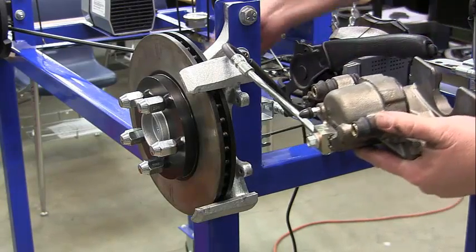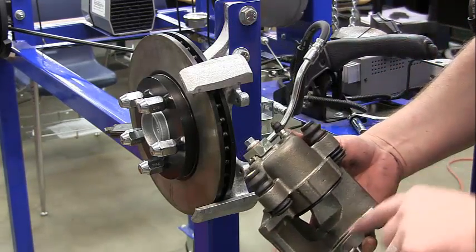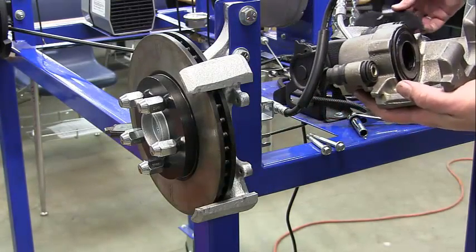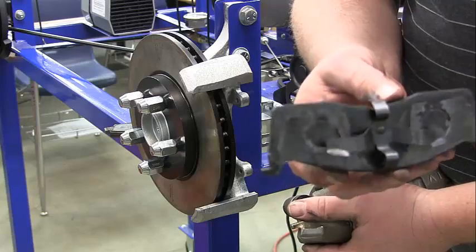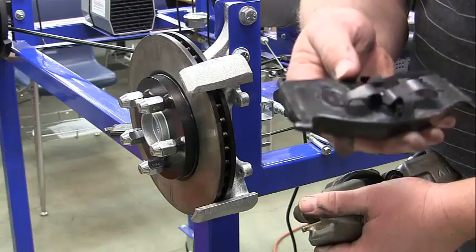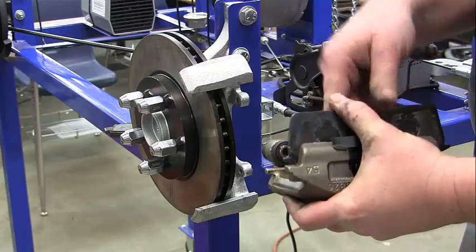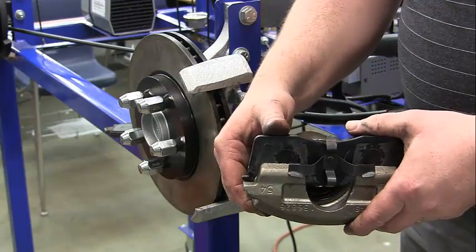When reassembling on an actual car, make sure these surfaces are clean — no brake dust or dirt on the piston. On the pad backing here, you can see I've got this gray-looking material — that's called anti-seize. Put that on anywhere the pad has metal-to-metal contact, right where the backing plate hits the caliper. Just know that we want to use anti-seize wherever we have metal-to-metal contact.